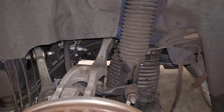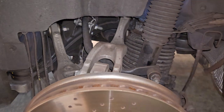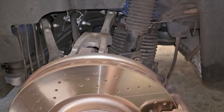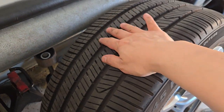I'm going to reference the suspension here. I'm going to get adjustable upper control arms so I can actually adjust the camber a little bit. I noticed there's a little bit too much cambering going on in the rear. The front is fine — as you can see from the tires, the way they're touching down they're nice and even.